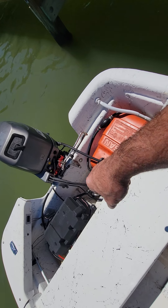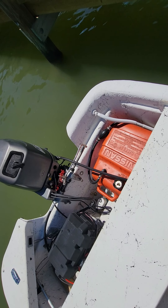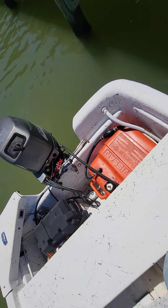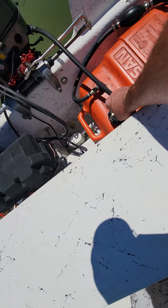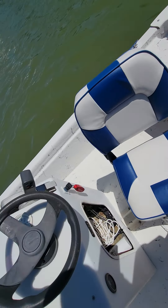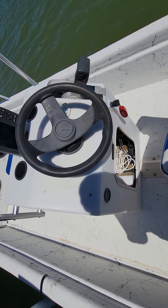It's running good so I don't think you'll have any problems. When you get the boat lifted up, make sure you take the drain plug out so if it rains the water has a place to run out. Then shut the vent back off, cut off the battery, and you're good to go. Hopefully you get a chance to use it and everything works fine.